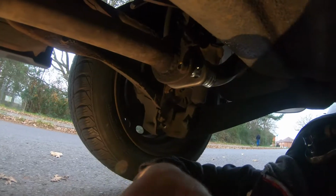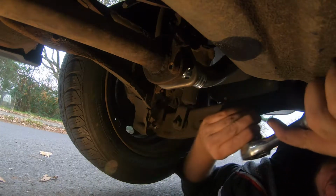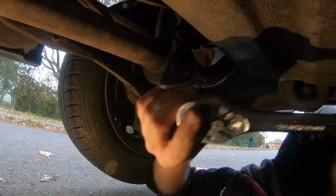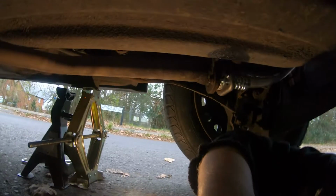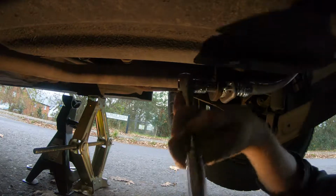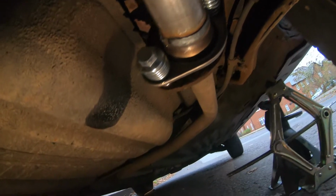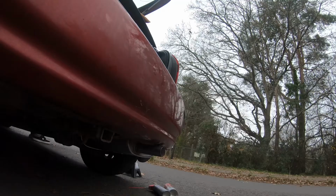So I don't know if you saw that, I used the pipe grips just to squeeze this spring on here. So now we're gonna hopefully give it all a tighten. Right, so there we go, they're both tightened now. Got the washer in there so it won't blow. All seems nice and secure, nice and tight. Nothing knocks when you give it a wobble. So now we can start it up and see how she sounds with an exhaust without a hole in it.